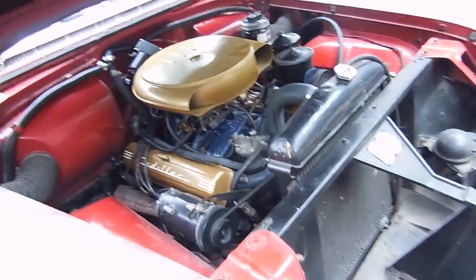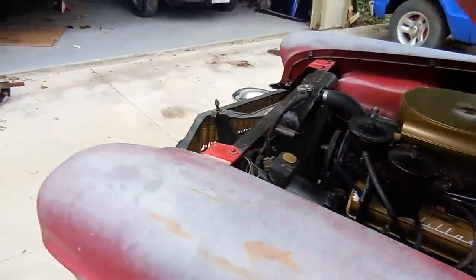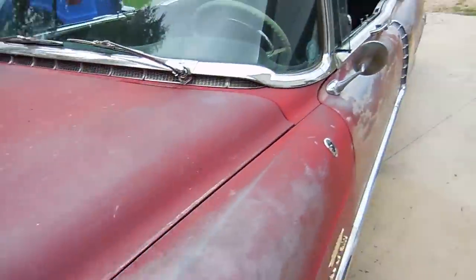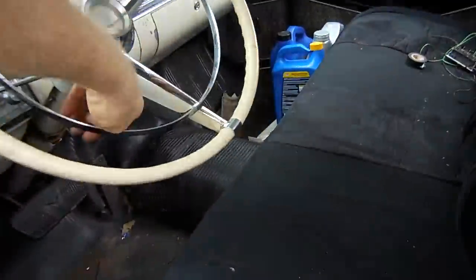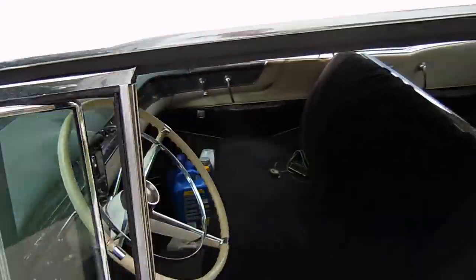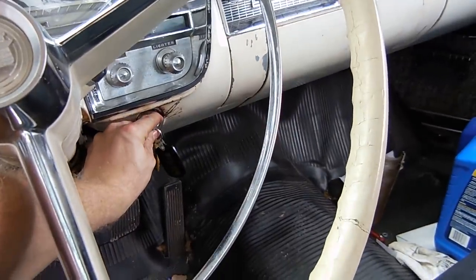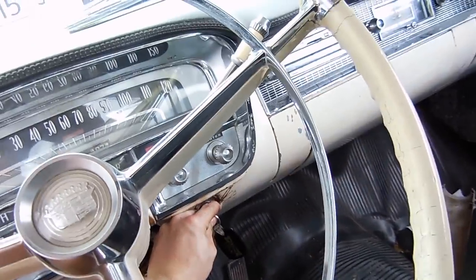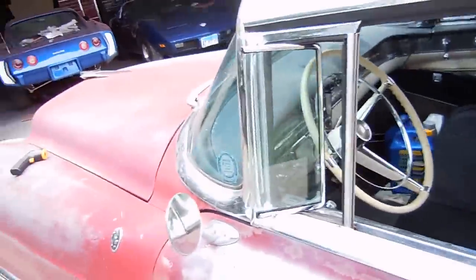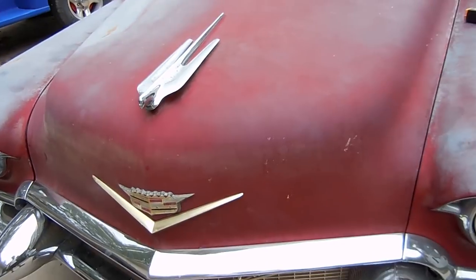So maybe those plugs by themselves aren't enough. Maybe I do need one of those phenolic spacers. So let's close the hood, and turn it off. And let's let it heat soak. After a little bit of heat soak, let's see how it goes. According to the temp, we fell some, but... Nope, it didn't really do much. So it looks like my only solution is I need to get one of those phenolic spacers.